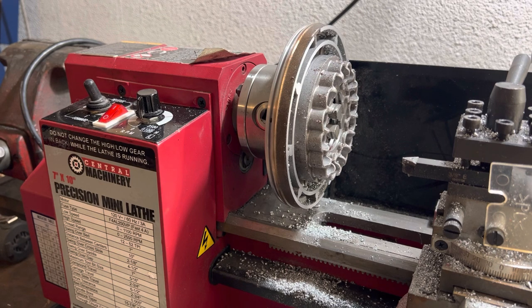Unfortunately when you're using factory drums you can't really fit all thick steels and still get six clutches in there. As an example, if you're going to do a heavy duty five clutch stack — five clutch discs and five 90-thousandths or bigger steels — you can get by with cutting your apply piston to about 650 to 660 thousandths thick. That will handle a thousand plus horsepower. A heavy duty five clutch stack will handle well over a thousand horsepower if it's set up properly with the right clearances.